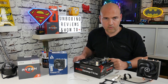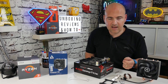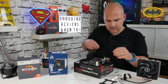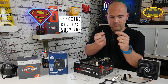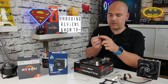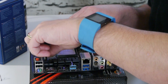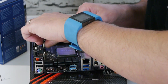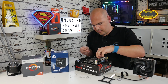The next thing to do is install the mounting pillars. In the box you get three sets of mounting pillars — for AMD, Intel 115X, and 2066. For this installation we want the AM4 ones. On the pillars themselves there's a slight indentation: no marks, one mark, or two marks. For AM4 you want the one with one mark. Using the coarser thread, hand-screw these into the four mounting areas. You can use a box wrench to tighten them, but hand-tight is sufficient.